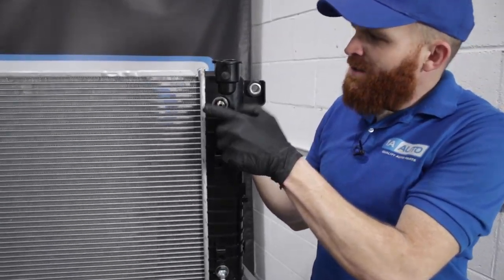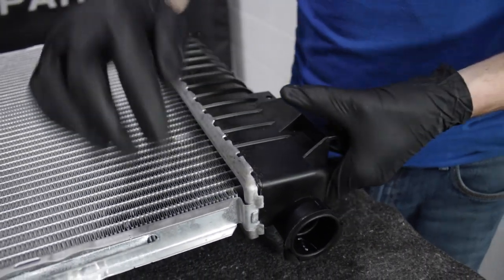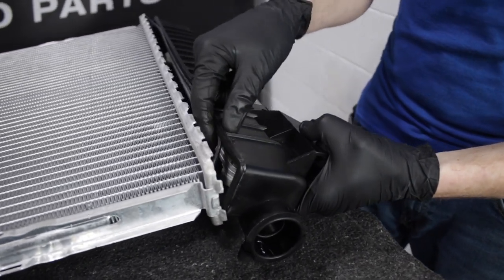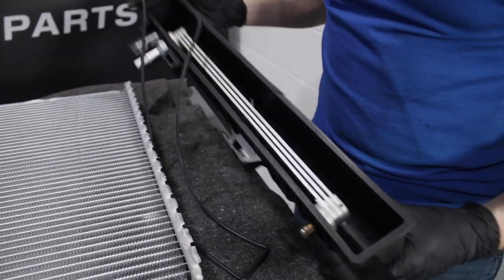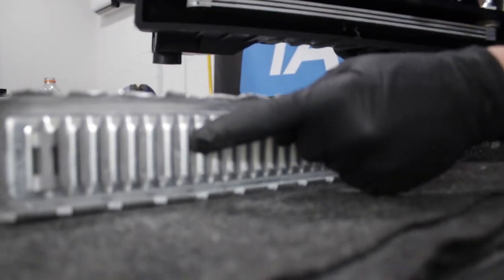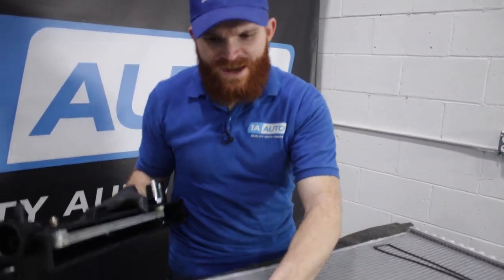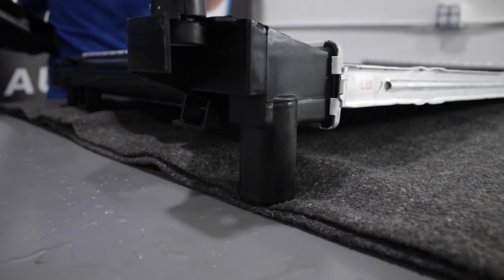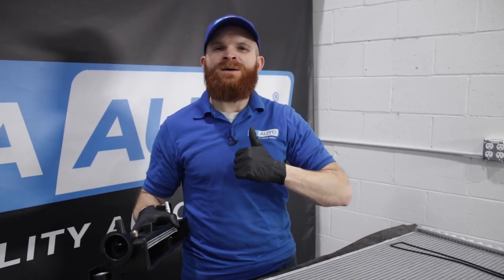I took the liberty of peeling all these crimpies up so they look just like this — you can do that with something as basic as a screwdriver. Giving it a little twist, you can see the seal. Pulling further, we can now see right inside of this tank. As you can tell, the transmission cooler unit is a completely separate unit from the inside of the radiator where the coolant rides. You can see these slots coming down along here — that's where the coolant gets forced through. As it comes through these channels, all these little fins have air blowing through them, cooling down that coolant before it gets pushed back to the engine to run at the perfect operating temperature.